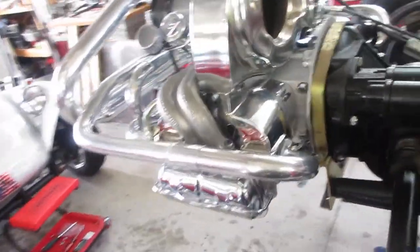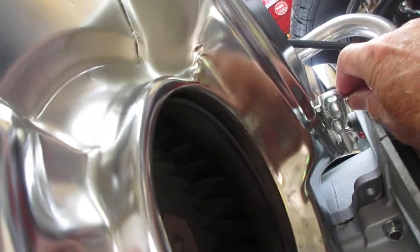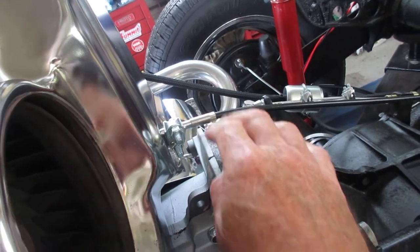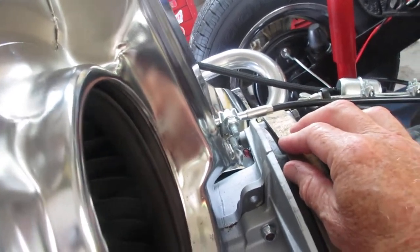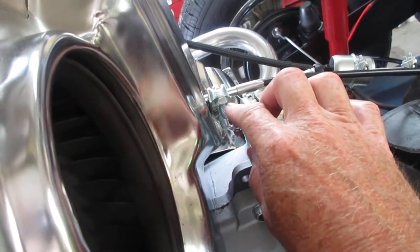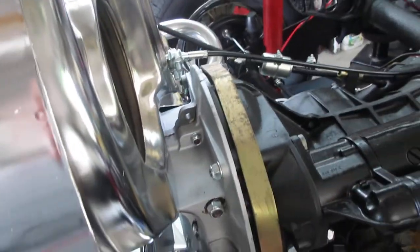And, hey, I don't know what you all do for this tube that goes through the fan housing. Actually had to shorten this one to get the right rake on that tube for the accelerator cable, but I just use a wire clamp for 5/16, tighten the damn thing down, done with it.